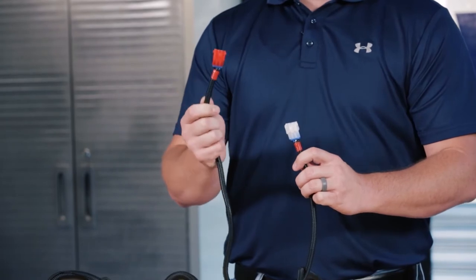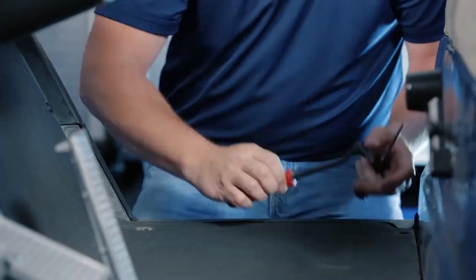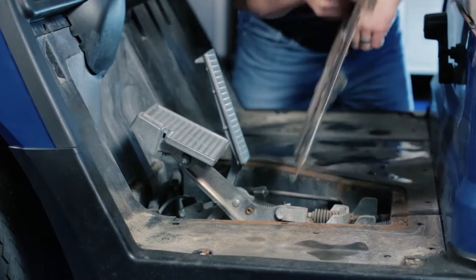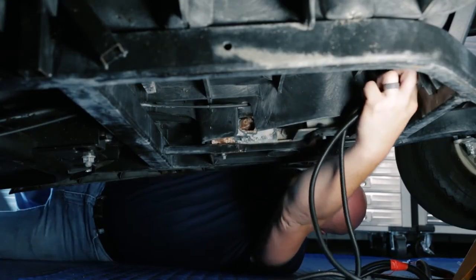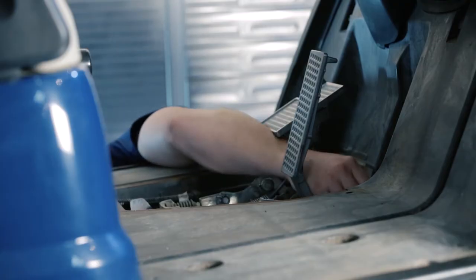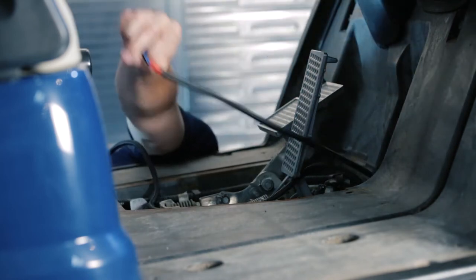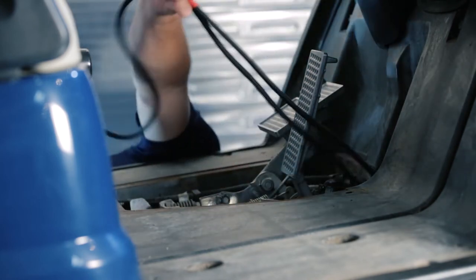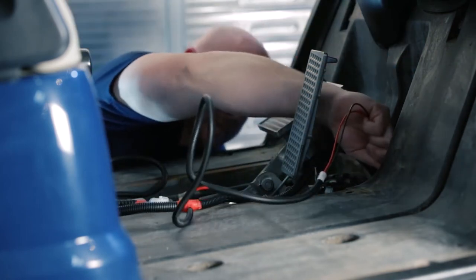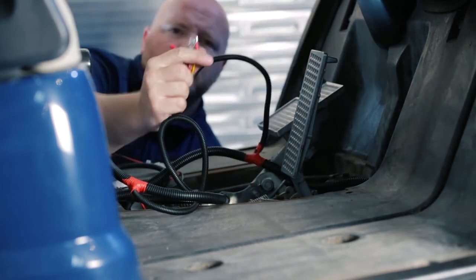The passenger side has the red connector. The first thing we're going to do is remove the factory floor mat and retain all the push rivets. Then remove and retain the brake access panel. Now we're going to run our harness into our brake access, starting with the tail light pins first. You're going to follow the main cart harness through the hole here behind the accelerator. You're going to pull the harness until the brake switch hookup connectors are in the brake access. Next, we're going to attach our relay harness to our 12 pin connector and then put the rest of these wires up to the front.